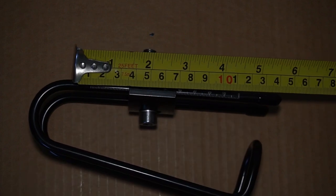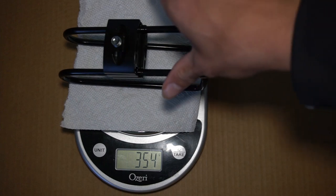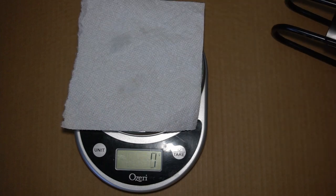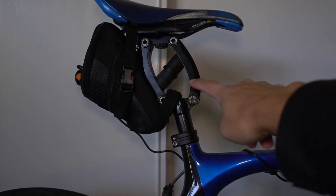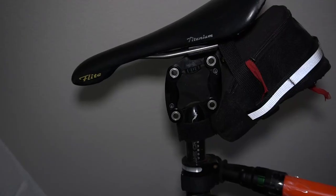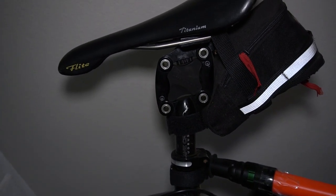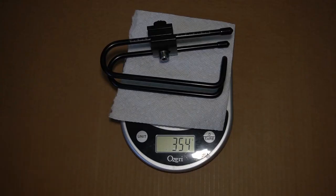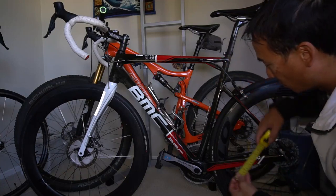As mentioned, it's not that light — 354 grams, nearly an extra pound on your bike. In my last video that seat post was about 600 grams, and in another video I covered the short-travel Thud Buster at about 460 grams. Even though this is lighter, it doesn't account for the seat post you have to attach it to. With an ultralight seat post you're still adding about 180 grams, making the total seat post setup probably around 530 grams.